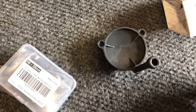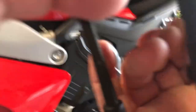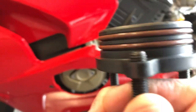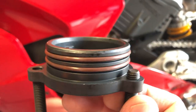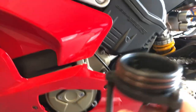The proper method is this, and this will hopefully make sense. If not, you can leave a question in the comments. You take your M8 bolts, you screw three of them in — just pretend this is still on the engine block — just like that. And you start torquing these down little by little, evenly, and these will push through. Since these M8 bolts are larger than the diameter of the holes that actually hold the cover onto the engine case, they're not going to go into those threads — they're bigger. So these are going to be used as a puller; they're just going to start pressing up against the engine block. And as you tighten these down, this cover will come off.